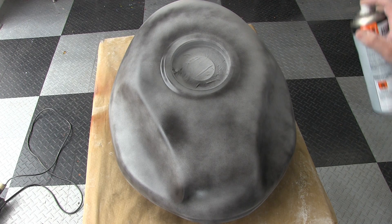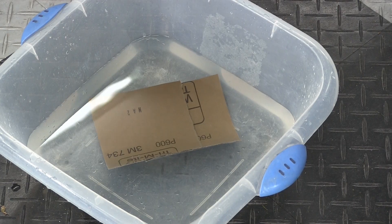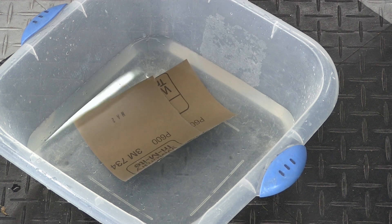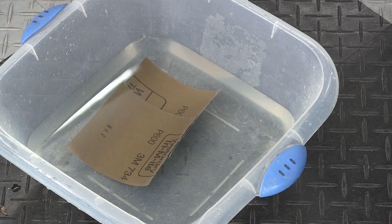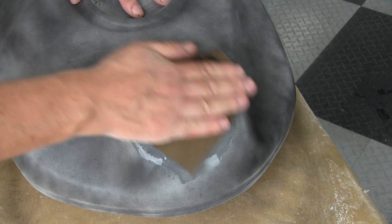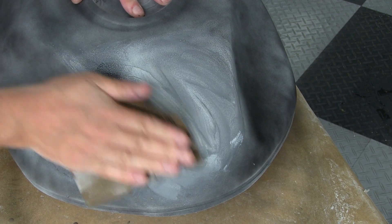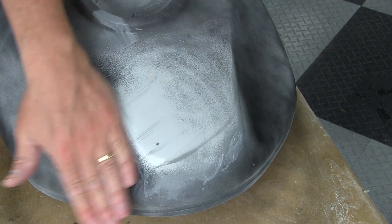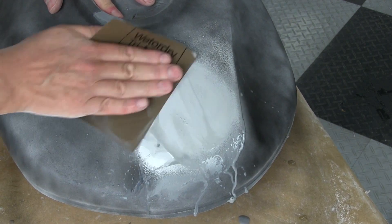Once I've left it I'm going to come in and sand it. The first thing I'm doing is using a black aerosol — this is called a guide coat, and what it does is let me see where I have to sand. I'm going old school here using some 600 wet and dry sandpaper, putting it in lukewarm water and leaving it for 5 or 10 minutes before use — it makes it more pliable and easier to use. I'm going to sand until there is no more black left. Without the guide coat it would be very difficult to see imperfections, whereas with it they're quite visible because of the black aerosol. You don't have to, but it just makes life a little bit easier.